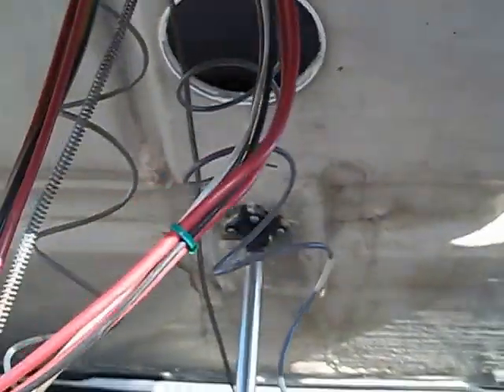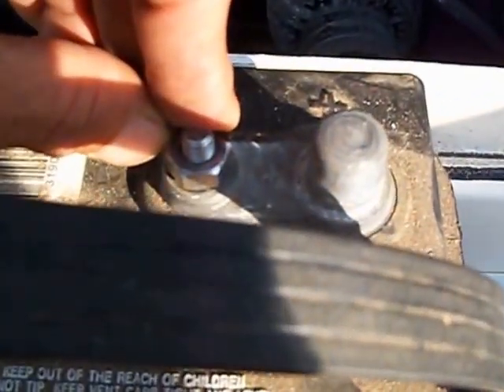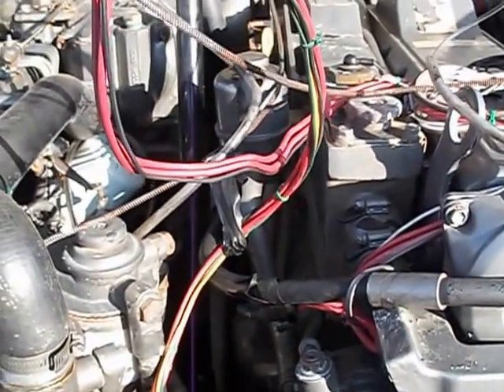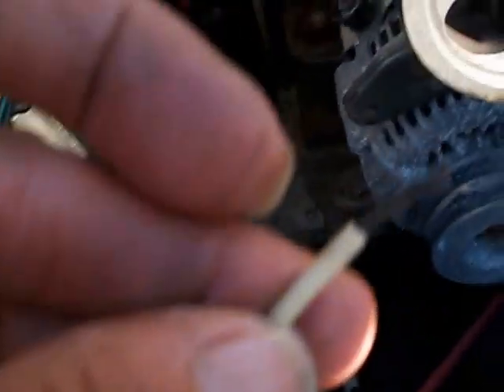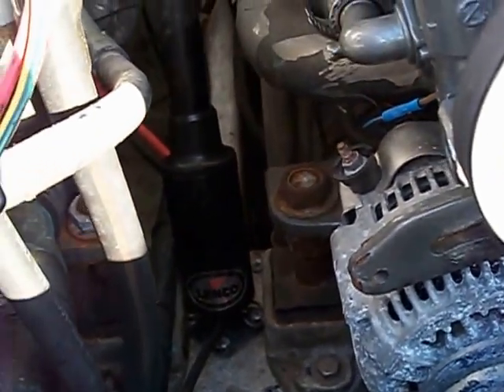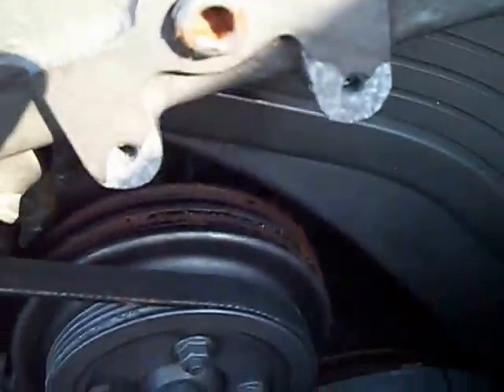Anyway, she sounds like she's straining on the way up, and the wire is getting a little bit warm. You'll notice for the full travel there's nice black wiring that goes all the way into the Lenco motor. So chances are he's going to need a new lift.